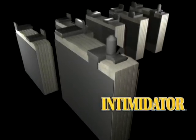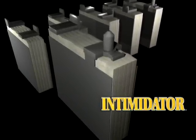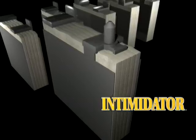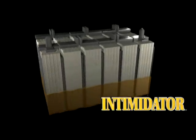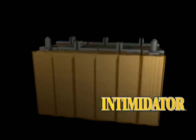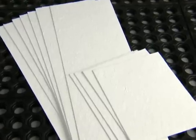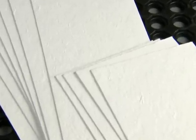What's inside really does make it better. The most prominent difference between an AGM and flooded design is the use of glass mats that absorb all of the battery's acid. That's why it's called an absorbed glass mat battery, or AGM for short. The glass mat used in our batteries is definitely not your ordinary type of separator material.